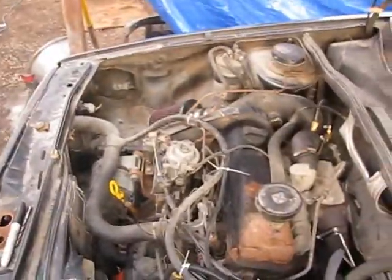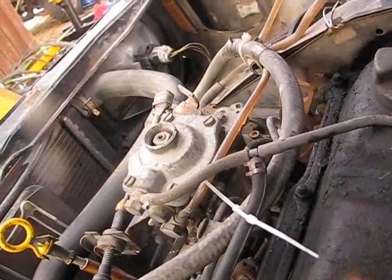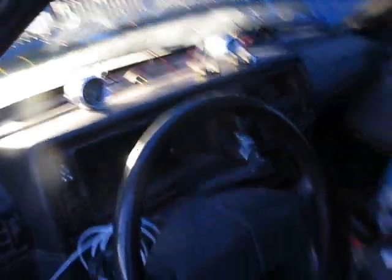I've also got to install my boost gauge. What I'm gonna be doing is replacing this little guy with the other guy. It's starting to get dark and my batteries are gonna die. Anyways, I teed off here for the boost gauge. I'm just gonna run these two together like that and put them in one solid piece of loom up to there. I got them pulled up into the cab and then I'm gonna mount the gauges there. If I can record anything else I will try. If not I apologize, and I'll see you guys in the next one. Take care.